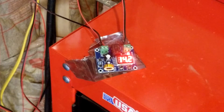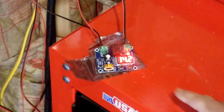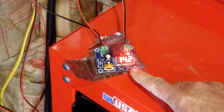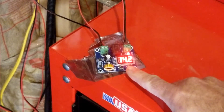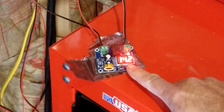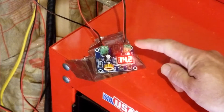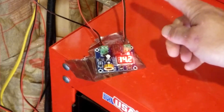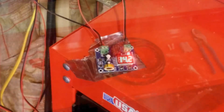How about that? We're getting 14.2 volts now because the alternator is spinning and generating electricity, which then overcomes the 13.5 volt DC threshold that we put into the system. That illuminated the light indicating the voltage is now flowing from here into our device, which then turns on the DC charger and the battery will charge.